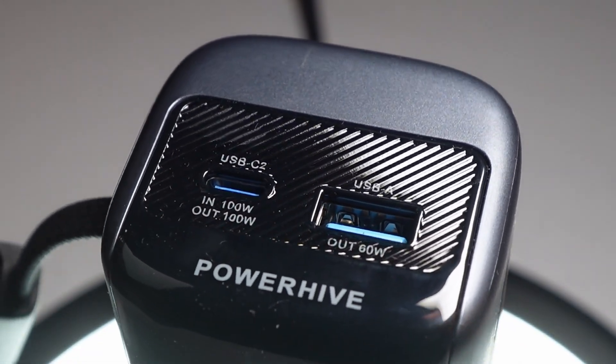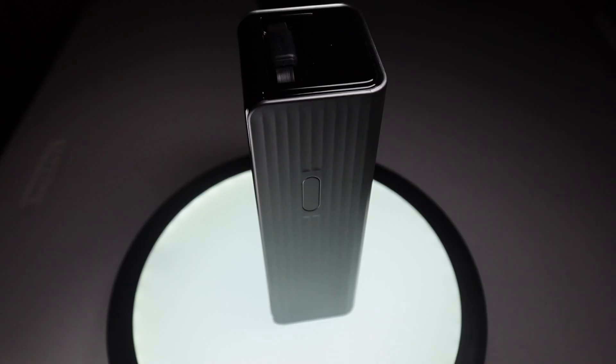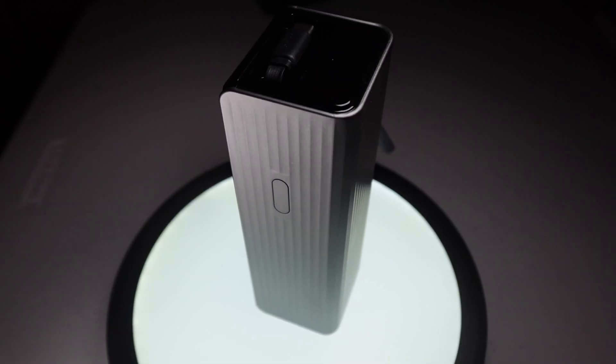The Vention has a total estimated charge time display and a little LED readout that gives you a smiley face at 100% charge. The downside is only three USB outputs — two USB-C and one USB-A. It does come with a 240-watt USB-C power cable, and the lanyard cable is 140-watt. The fact that the Vention performed best in my battery testing verifies it's a legit product, and the build quality feels solid. It's the same size as the EcoFlow. I'd buy two Ventions — it's also about $15 cheaper right now.